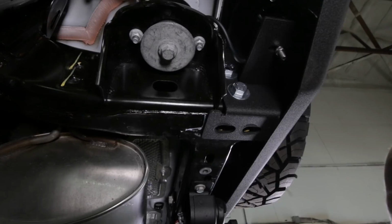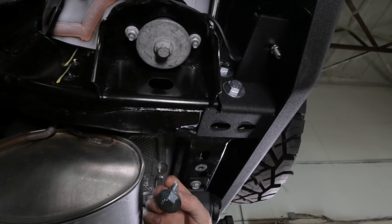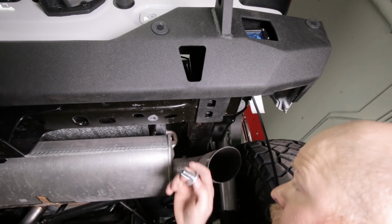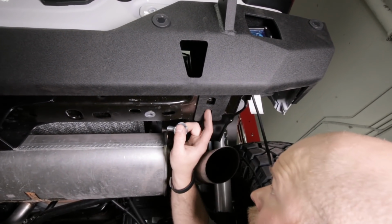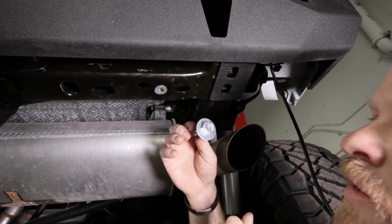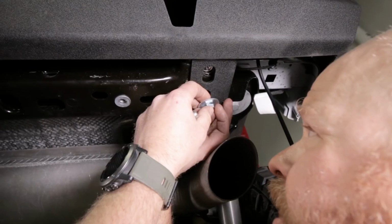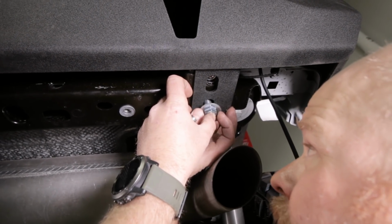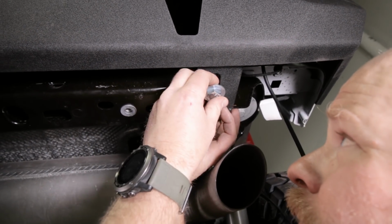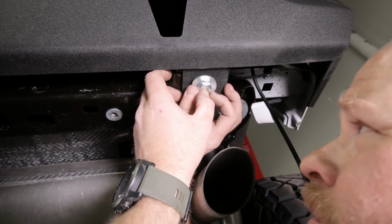On the passenger side, you're always gonna use that nut insert plate that we gave you. And on that plate, you're always gonna use half inch coarse thread with the three hash marks right there. Go ahead and install everything loosely. On the passenger side, we're gonna make sure that those nut plates that we inserted are centered in the holes. And then we're gonna use these coarse thread bolts on that side. They have the three hash pattern on there, coarse thread. And we're gonna carefully start those a few threads without moving that plate. Both of those go like that. Make sure you use the washers we provide on there.